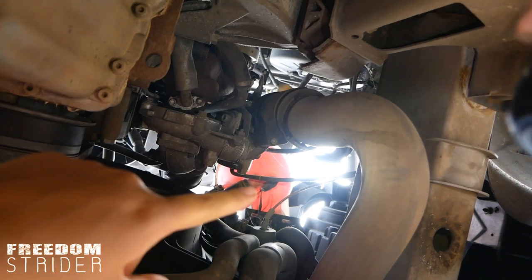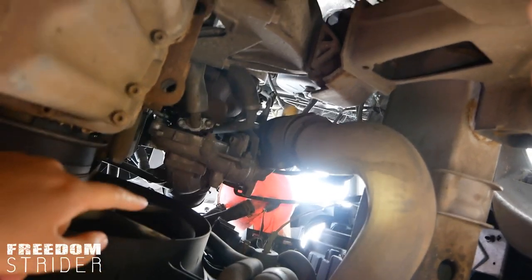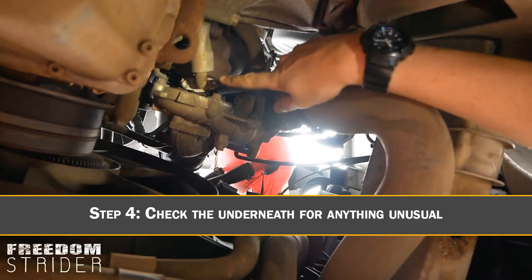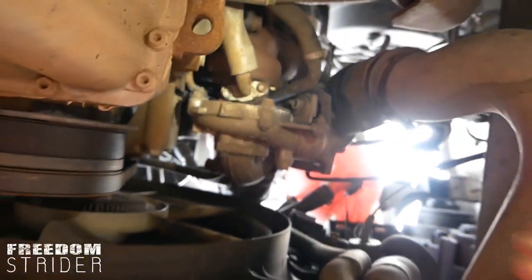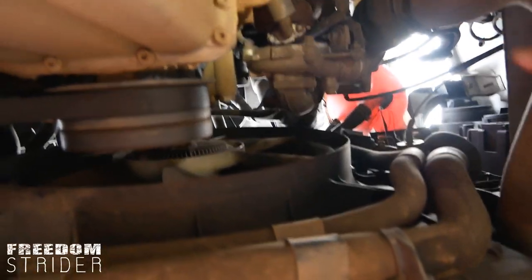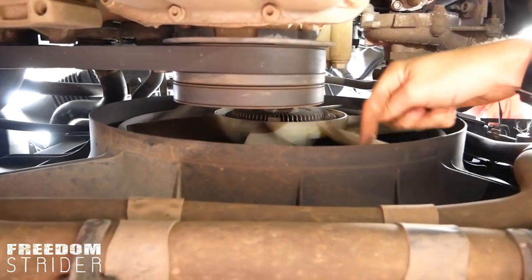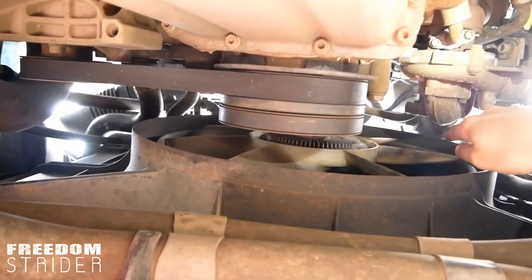That's the coolant — you can see the colour a lot better from down here. That's the coolant reservoir. Keep the bonnet open because that gives you more light, and you can orient yourself clearly. Check for anything that doesn't look quite right. The engine looks used, and even though this engine is only five years old, you can see a little rust patch here. Some of the metal looks a rusty colour — that's not too much of a problem, rust will happen all under the vehicle. Also check the fan — check that it's not broken. You can actually spin it whilst the engine is off to check all the fan blades are in place, as this runs your air conditioning and cools down your coolant.